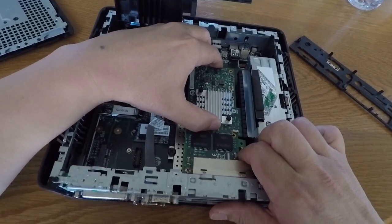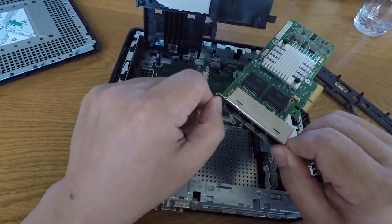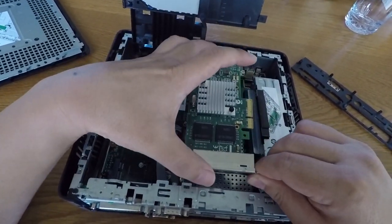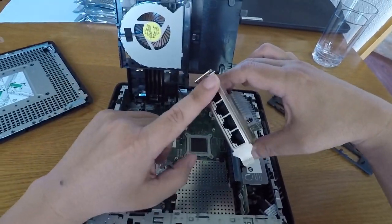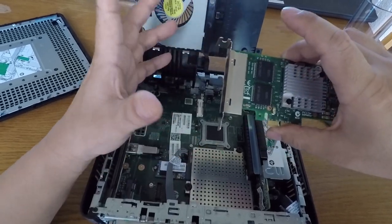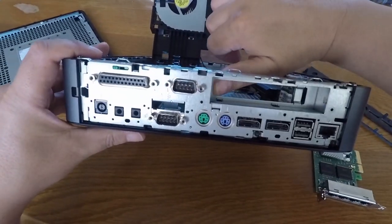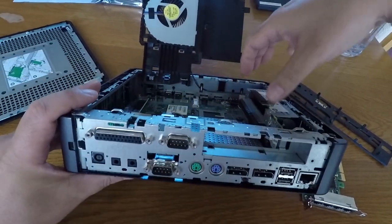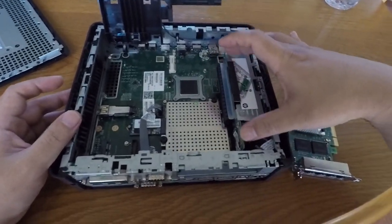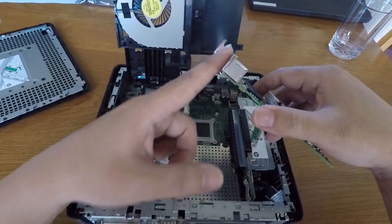I have a quad-port network card in here — you just slide it out, there's no screw holding it to the chassis, and it seems fine. One thing to note: this particular Ethernet card is easy because everything is flush with the PCI bracket. If you're using something like a 10-gigabit card that has something protruding, it can get hard to remove because it'll hit this spot here. In that situation, you may need to remove the riser card to give yourself room.